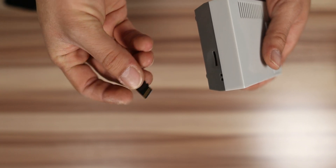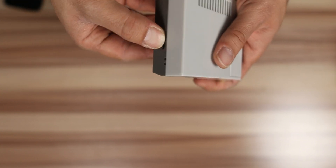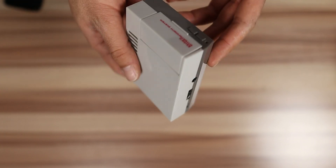Install and run the tool. Be sure to select the correct device where your SD card is, because if you pick the wrong device this program could erase all of your data. When it's finished, insert the SD card into the micro SD slot on your Raspberry Pi.